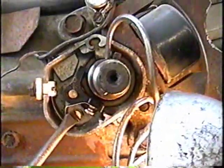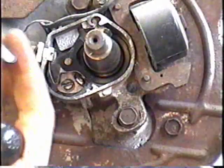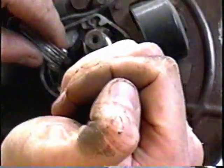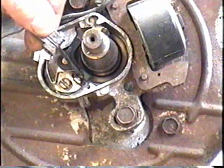So I'm just going to loosen this screw. I've got this little screw loosened up and I expanded the points a bit. I'm going to check them again with my 20 thou feeler gauge. I've got it open a bit too much — I'm just going to close them up a bit by pushing up like that. Then I'll tighten it up. Try my gauge again.